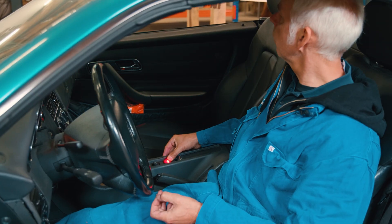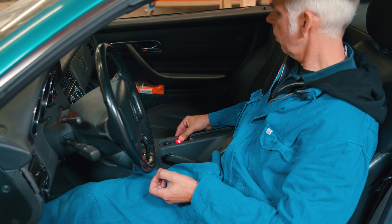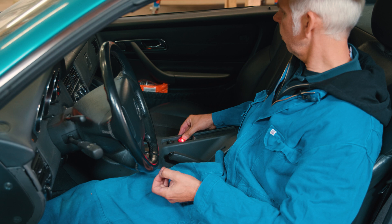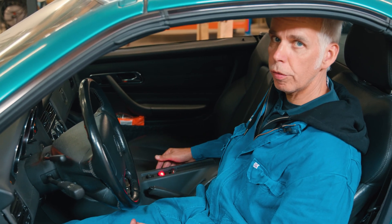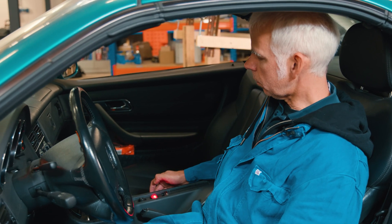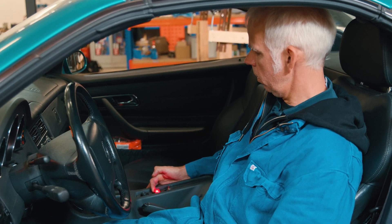An example consequence is that when closing the trunk hydraulically without success feedback, there will be no pump shutdown and no control to raise the rear windows. You can tell the pump won't stop because it keeps trying to forcefully close the rear locks. Upon restart, we should receive an error message. Therefore, the next point will be the pump wiring.